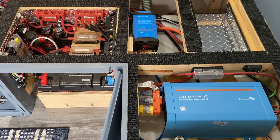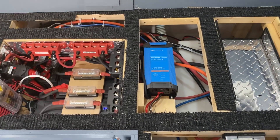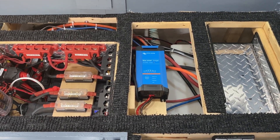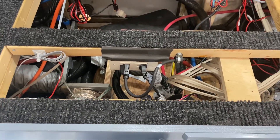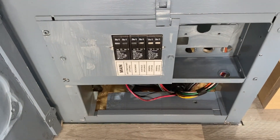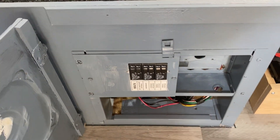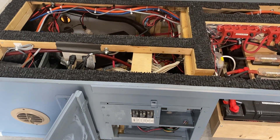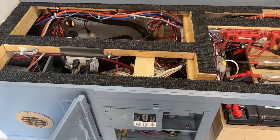The 600 watts of solar had the batteries fully charged back up the next day, usually by 10 a.m. I was really happy with the performance. You can see the Phoenix there, and I've also got the Victron Blue Smart Charger. That's plugged in over here — if I run my generator, that plug is energized by flicking a breaker on the old AC panel in the RV. Combined with the DC-to-DC charger, solar, and the Blue Smart Charger, I'm pretty well guaranteed to keep my battery bank charged no matter the weather.